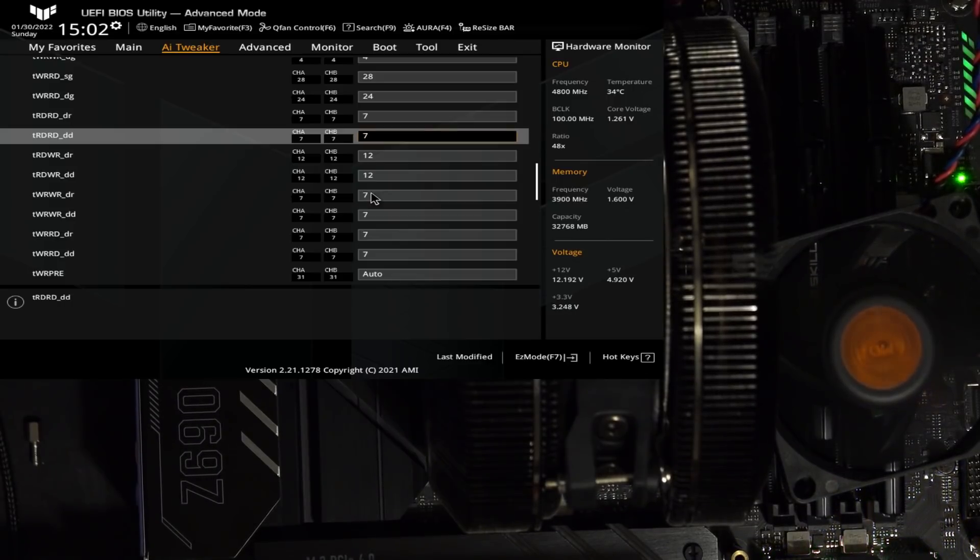For dual rank, this is certainly a lot better than the Gigabyte board currently. If Gigabyte ever sorts out their DDR4 BIOS, they might actually end up having an advantage because 1T command rate just works on the Gigabyte board. If that 1T behavior held up to maybe 3900 megabits per second, that would be a win for Gigabyte. There's a chance they might never get the memory overclocking on par with ASUS, so I don't know when or if we'll see BIOS updates for Gigabyte DDR4 boards addressing the actual memory overclocking.